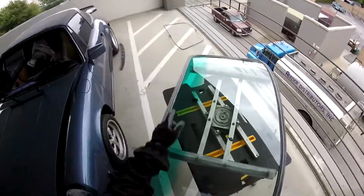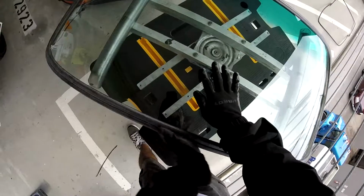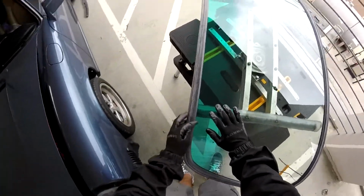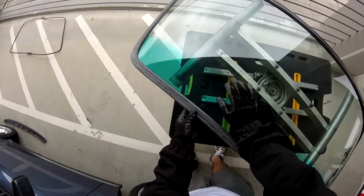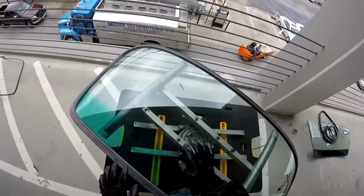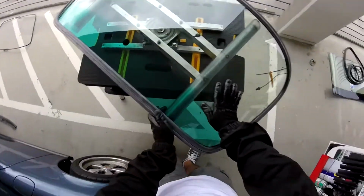Now inside the gasket is the retainer for our moldings. Before I put my molding, I have to seal it. I'm going to open here and inject the glue inside, and when I pull that one in, it's going to squeeze the glue out and hold the molding. I probably have to clean the excess, but I'm not going to use too much, so you don't have to clean too much. So that's for this one.